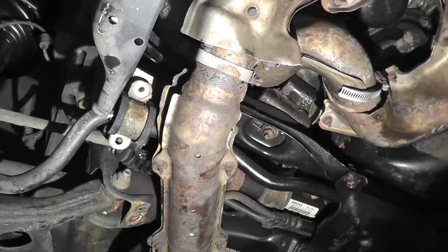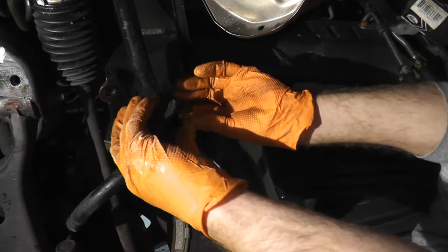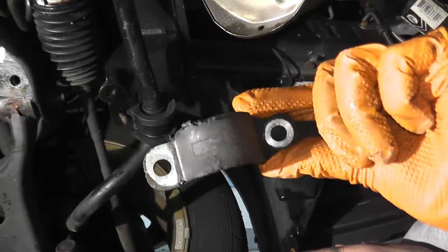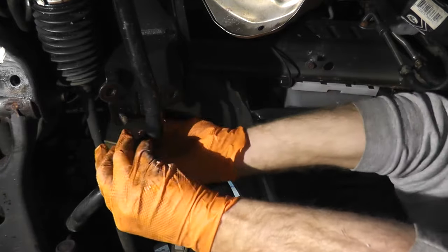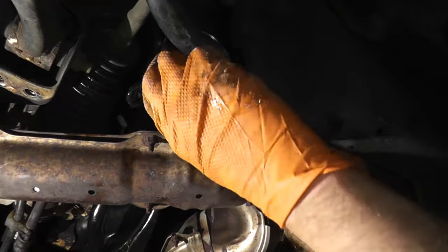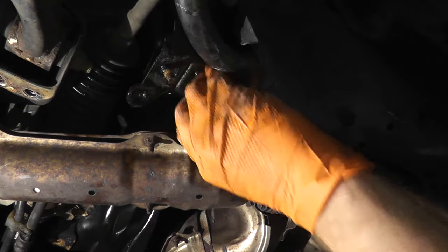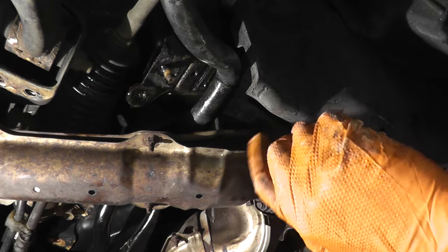On the driver's side, when you remove this bracket you'll see there's an arrow pointing forward — so when you reinstall this, make sure the arrow is pointing forward. There's a slit and there's your old bushing. On the passenger side, same thing — note where the arrow is pointing and just slide it right off. Really the hardest part is sometimes just removing those fasteners.